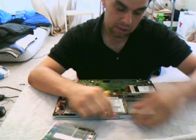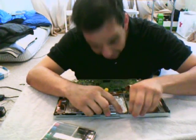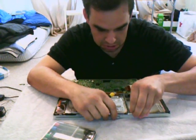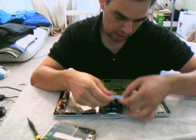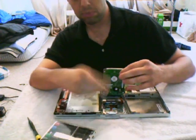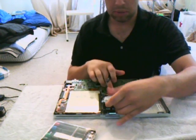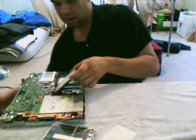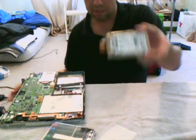The first black screw over here loosens this part of the housing. You can actually lift it up carefully — don't manhandle it — lift it up carefully and push it to your right. What that allows you to do is freely work the drive out. And there you go, drive's out. Take off this little plastic piece here which protects it, arc it out on the bottom, and what you have is the ribbon cable. This thing actually comes off your motherboard.